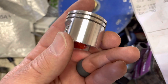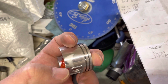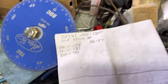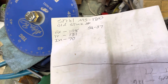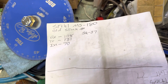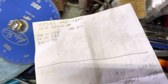The piston actually is pretty nice. It's got a nice bottom chamfer to it down in here. The edges are a little sharp on the side, but that's easy to take a little piece of sandpaper and soften those. I was kind of surprised how nice beveled this bottom is. I'll be able to throw that in there, see how it goes. I was also looking at maybe giving it a little bit more intake to about 75-ish, so maybe five degrees intake. That's 23 degrees of blowdown — minus the 108 from the 131, you get 23 degrees. Some fuzzy math off the top there.